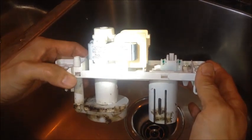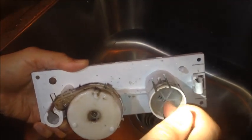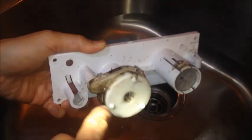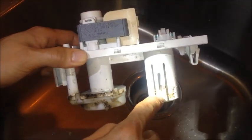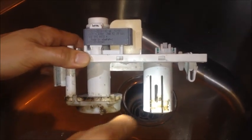What we're looking at here is the sump pump or condensate pump for a Bosch condensing washer or dryer. This piece right here is the float. You can see how that float is not moving quite freely, and you can see this algae on it. Here's the pump — you can see the algae on it there. I believe this connector here is some sort of a magnetic connector that senses when the sump is empty and stops the pump. The problem is that this is getting jammed up with algae.